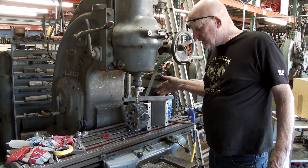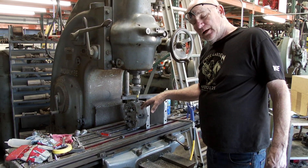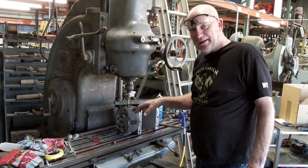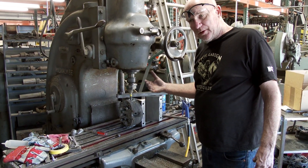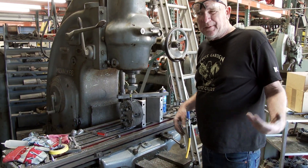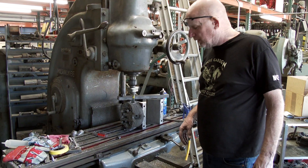But they don't breathe this good. A lot of these heads we're doing today have been sitting around for 25-30 years, because I don't hardly ever use them. I use the El Dorado heads - they've got a bigger bore, they breathe easier, especially with a big bore kit. It probably gives maybe three to five extra horsepower, torque, all that.